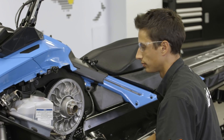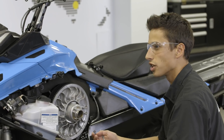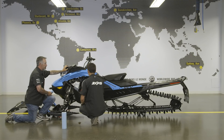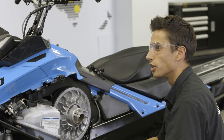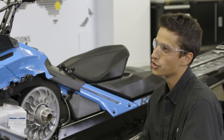After your clutches are clean and belt height is set, you should check the belt adjustment after a few kilometers of riding. After a couple of rides, it's always good to check your belt height adjustment — you might just take a look and see that it's fine, or if it's too low, pull the belt back up in the driven pulley as demonstrated. It's just preventative maintenance so you're not stuck out in the bush by yourself. We always want the best performance possible, so these are little things we can do on our sled.